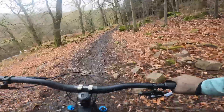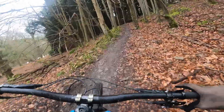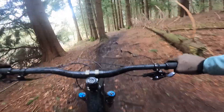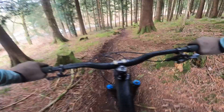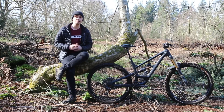YT's revision to the bike's geometry makes the Capra a really easy bike to get on with. The new seat tube angle places weight very nicely over the pedals for a comfortable position from the start, and the new 467mm reach helps offer a slightly roomy cockpit. However, it's definitely not the longest reach in the world — bikes like the Specialized Enduro and Nukeproof Mega both get reaches north of 475mm. That said, the shorter reach makes the bike accessible and comfortable, and really easy to get on with from the first go.